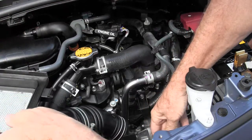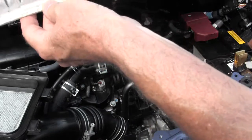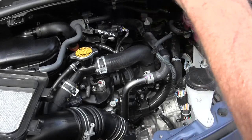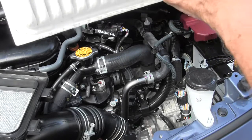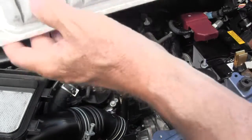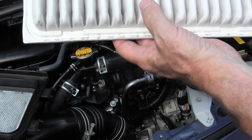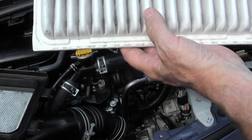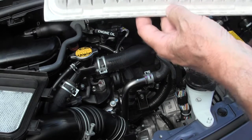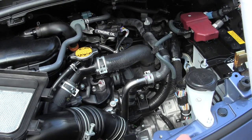We'll set that aside. Now we're going to take out the old air cleaner. As you can see, there's a lot of dirt in it — a lot of stains, all kinds of specs and dirt. This is only at 7,500 miles. Fram recommends you change them out at 12,000 miles, Toyota recommends 30,000 miles, and I recommend every 7,500 miles. You don't have to — you do whatever you want.